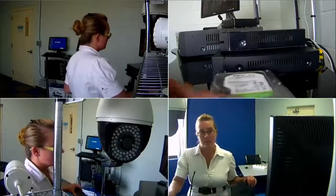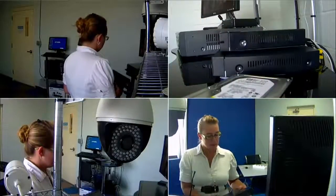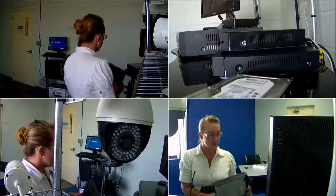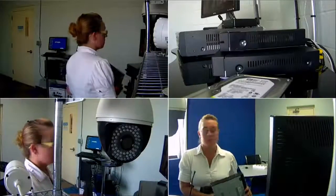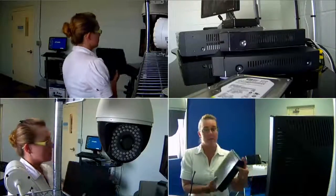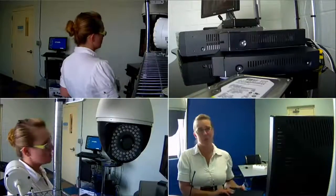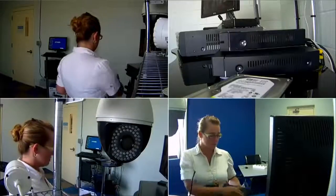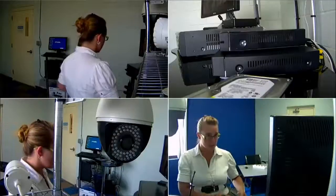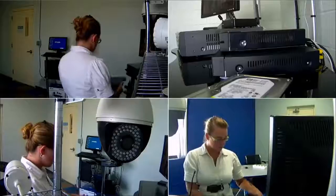This is relatively easy — there are just two cables involved. If you purchased a DVR or NVR without a hard drive, we will not have screwed the top on, so the top comes right off because there are no screws in there. That was intentional — there's no reason to screw it together if we're not installing a hard drive. If you order it with a hard drive, we will install it and screw the top shut.